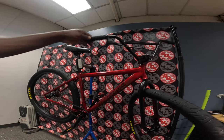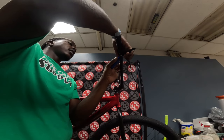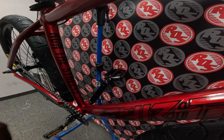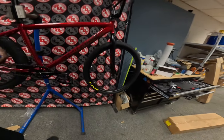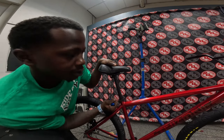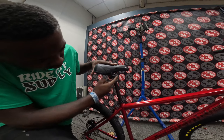One quick adjustment on the brake lever — it comes slanted down, so I'm just going to go in with my 5-millimeter Allen key, loosen that up, and move it over to the side because I got long fingers. I'm going to go ahead and check these cranks real quick — make sure these bolts aren't loose. You're gonna use a 6-millimeter Allen key, not the 5. Boom, those are tight.